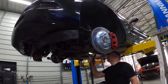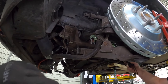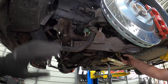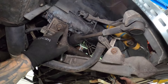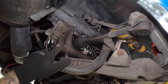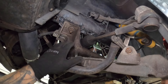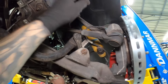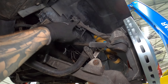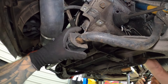Here's the way I'm doing it — someone else's video had them take the intake manifold completely off which seemed like way too much work. What me and my helper did was disconnect the shock to allow dropping the K-member, disconnected the upper A-arm bolts, and swung the sway bar out of the way so we could get access to the mount.